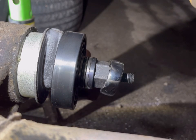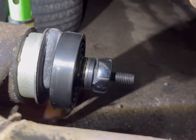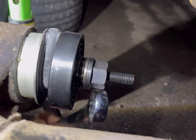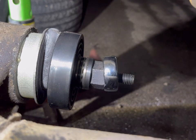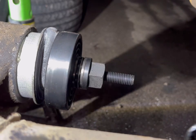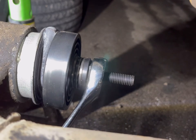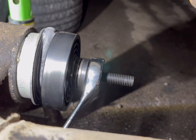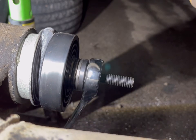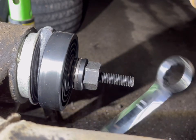We're just using a power hand press/pull sleeve kit — this one's quite a heavy duty one — so we're basically going at it, seeing how well it pushes the bush in. Unfortunately, because of the size of them, they're quite a bit of a pain to do. Sounds and looks like it's actually doing something, so that's always promising. It's not the quickest of jobs doing it like this. With this set being a more heavy duty set, the nuts are 27mm so they are quite large, and I don't have a 27mm ratchet spanner, so we're going at it with regular old spanners, as you can see.